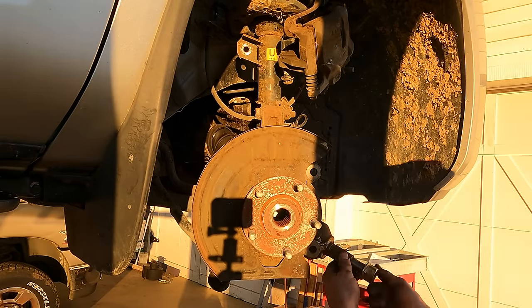There it is. That's your steering rack. This I unbolted. This is what goes into the passenger compartment. And there's a linkage with the steering column right there. And then inside here is the rack. And there's a pinion on the end of this. So when you turn the wheel, it's moving a rack back and forth. Goes to your tie rods, which of course turn the wheels. Let's see if I can get this exhaust.